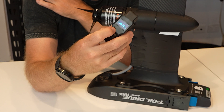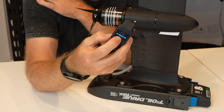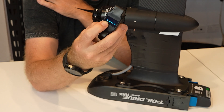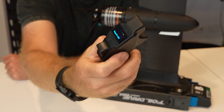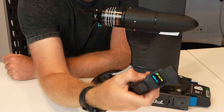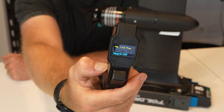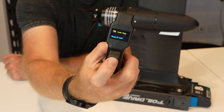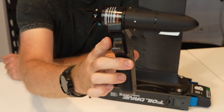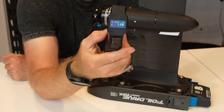As of 2024 for safety, the throttle lock feature — menu 10 — will come on by default, but you can turn it on or off. The one that isn't set by default because it's user-defined is option 11, which is throttle lock time. If I turn this on you will see there are three zeros. You simply press and hold the power button and scroll through each individual digit to select the time. I'm going to set it to five seconds — 5, 0, 0 — and press cruise control twice to exit out of the menus.